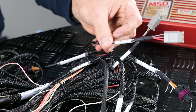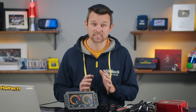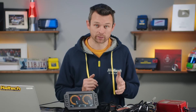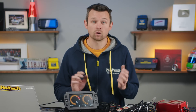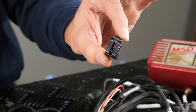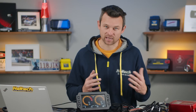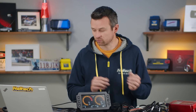The road speed input is pre-terminated with a three-pin connector that'll plug directly into the Haltech GPS speed input module. This module does need to be purchased as an optional extra, as the gold standard for measuring vehicle speed is a pickup from the wheel speed sensor. Although we recognize that many classics and hot rods don't have factory wheel speed senders, the GPS module is a convenient solution in this application. Of course we've got the power and ground wires, and because the wiring harness is pre-terminated and fully labelled, the task of wiring is pretty simple. You'll also notice that each of the sensors comes with a mating connector — they're included so that if you do need to shorten any of the pre-terminated wire lengths, you don't have to worry about salvaging the connector or finding one somewhere else. Just cut it off and use the new one provided.